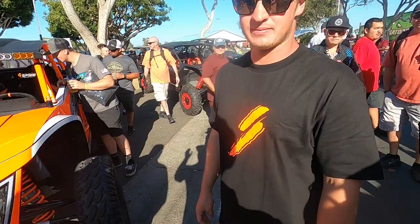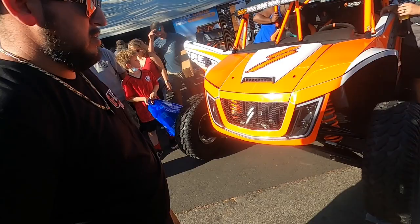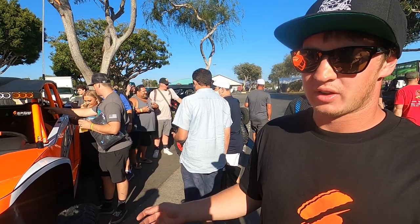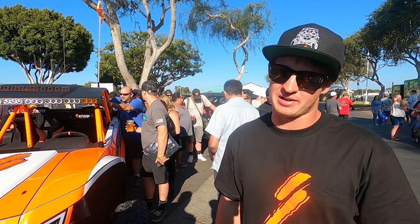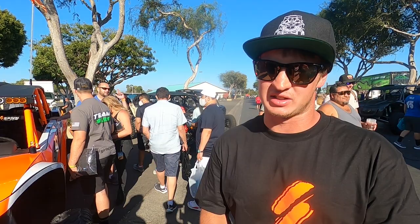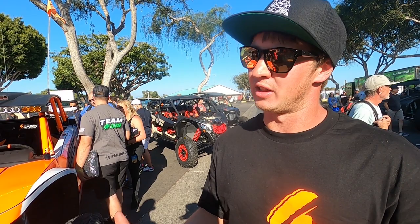I had one more question. I already forgot what it was. What about the tire packages? I know a lot of people like to run different wheels, like different billet wheels. Could they bolt up? Do you guys have your own pattern? It's a 4x156, so it matches a Polaris bolt pattern. Yeah, we've done a couple cool things that make our wheels work even better. We're actually hub centric with our wheels. We have a lip on our hub that allows it to support the load of the wheel versus it being all on the lugs. But any aftermarket Polaris wheel will bolt up.